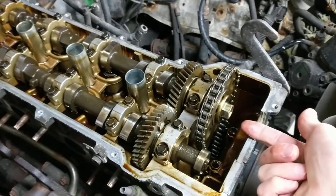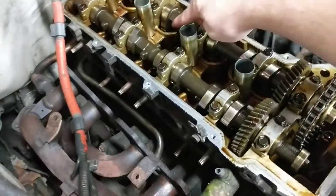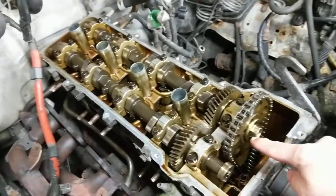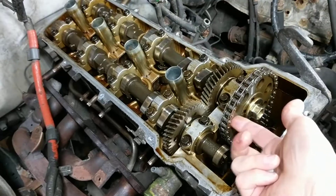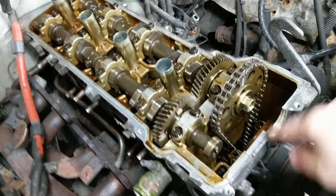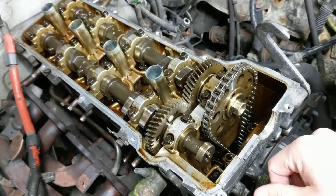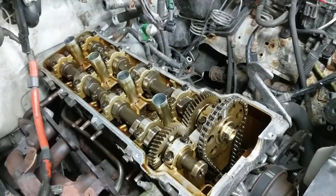It's probably better than getting a big wrench in here and trying to hold the camshaft. The more time you spend on this frustrated, the more likely you're going to break something. So give that a try and see if it works for you. I used a five-eighths inch round bar, but probably half inch or whatever you have laying around will work, as long as it can span across the gear. You could even use a screwdriver. I'd suggest putting some scrap metal underneath to protect the surface — even heavy plastic works. Thanks for watching, guys. We'll see you next time.